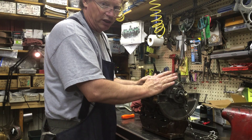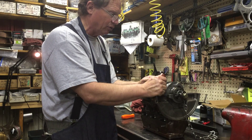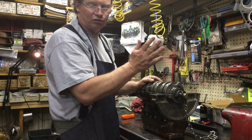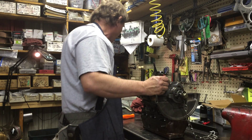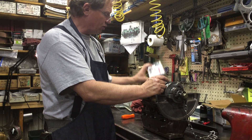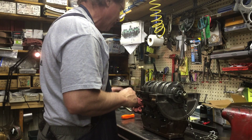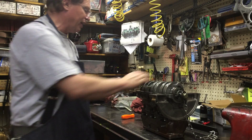Where you run into trouble is if you're putting in a 74 millimeter — this is only 71 and a half, so I still have pretty good original grooving. Whoever bores your blocks, if you're doing a 73, 74, or 74 and a half millimeter — which we have sizes for now in white — be sure to have them put a little chamfer back in there. That'll aid you tremendously. Alright, that's all — I still got to put the crank in. Tom Downey for Dodge, Iowa, signing out.